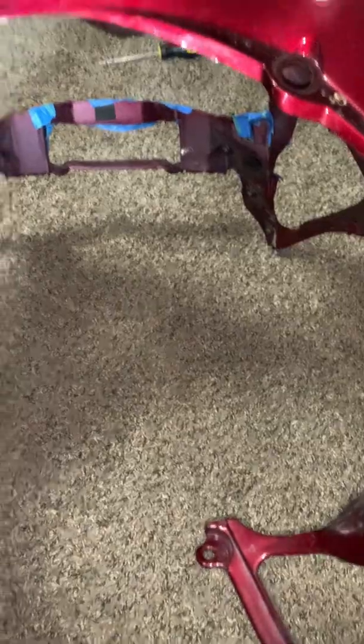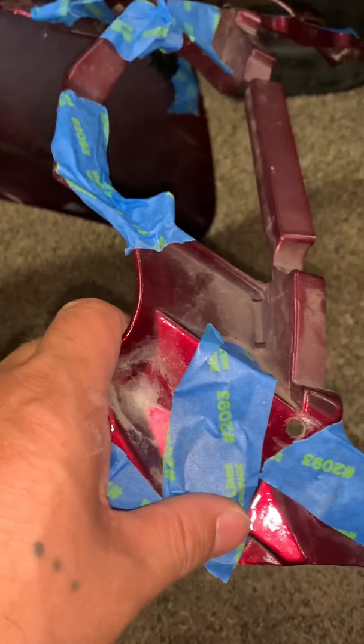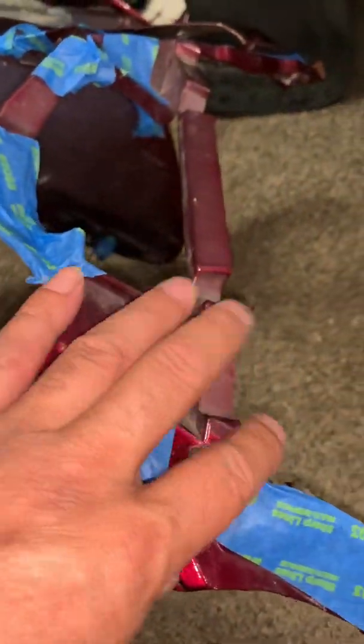Okay, I'm gonna take some masking tape and tape off stuff I don't want sprayed. Some of these screw holes, tabs, I don't want overspray or messing up the threads. Things that you don't want sprayed or to have overspray, you're gonna want to tape off, which I did here. This is all stuff that's pretty much hidden anyway. I'm not gonna focus on spraying any of this.